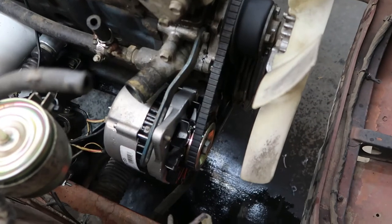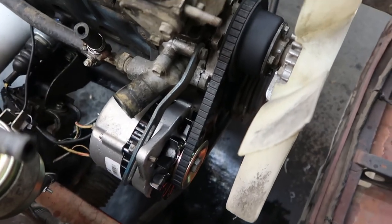As soon as I get another shipment of parts, I'm just going to leapfrog this project forward. This project will now be getting new injectors, new fuel rail. It will be getting set up with an external fuel pressure regulator. We will be moving it over to the EFI retrofit kit from Z-Car Depot that will replace all the sensors. It will give us the new computer and the new touchscreen setup, and it will delete the flappy box entirely.